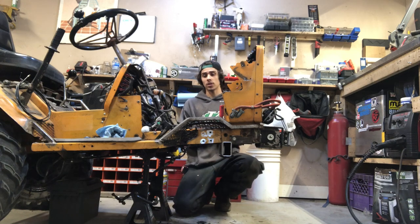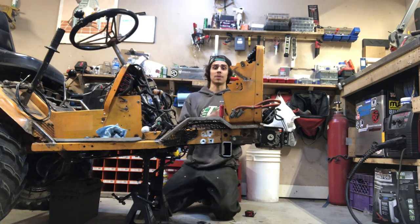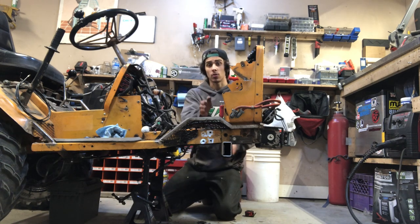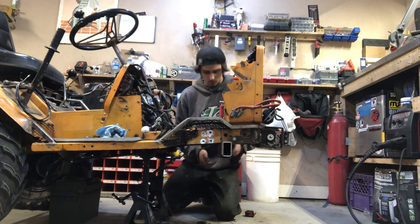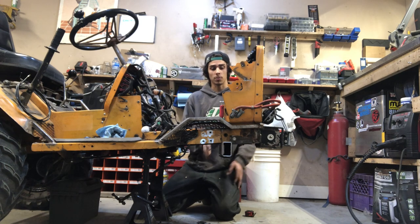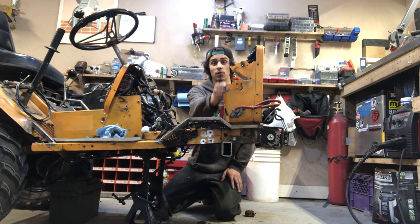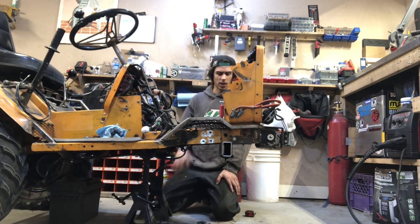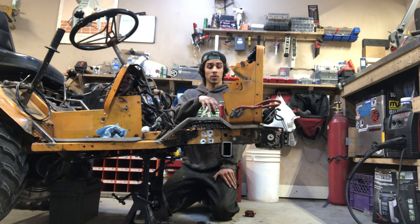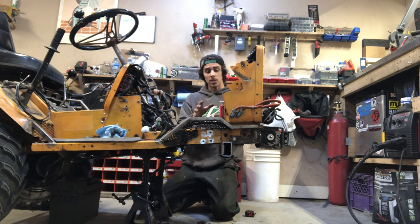The other challenge is that my front axle currently sits just in front of these four holes where I've upgraded the frame, and I want to get it an extra two to four inches forward. This front axle beam I have here is kind of like a two-by-four, three-sixteenths piece of metal — that's what I'm going to start with. There are a lot of challenges ahead: I've got to build and strengthen up the front of the frame, since the muffler used to sit through here and left two big holes. I'll be bracing the top and the underside, because that's where the front axle itself will get mounted.